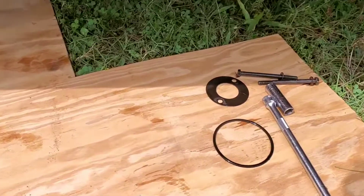However, these 2500 trucks have a unique system here where they're being four-wheel drive. They use this little tiny filter that sticks out sideways because they've got oil cooler lines that come off of these puppies. And I believe that this sandwich plate right here, the adapter, that is where our leak is. So let's get this guy off and fix it.